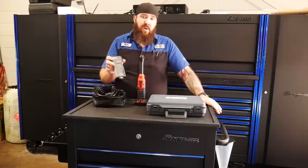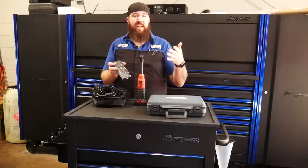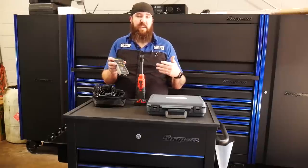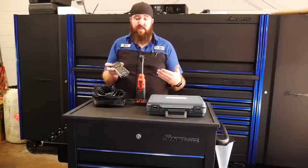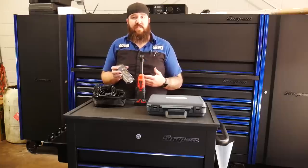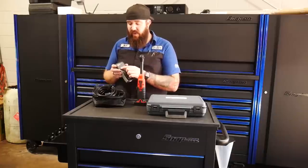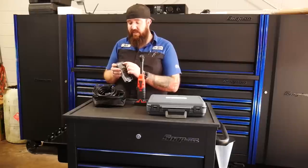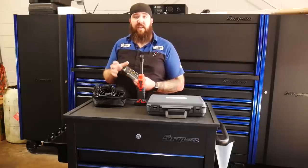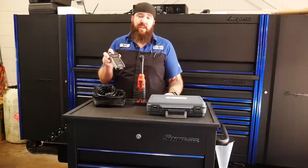This unit will actually put a load onto the truck and have the truck think that an actual trailer is hooked up. When you're putting it onto the screen of, say, the newer Rams, you're able to adjust the gain on the screen. Normally, without a trailer hooked up, you wouldn't be able to make all those adjustments because the truck doesn't know a trailer is connected. When you hook this up, the truck actually thinks a trailer is attached, so you're able to make the adjustments you need. You're also able to adjust your gain, pinch the controller, and right here these little blue lights will light up in sequence along with how much you either press the brake pedal or pinch the brake controller for the manual brake press. It's going to put a load on it and be able to test the full brake output so you know everything is working from your newer brake controller module.